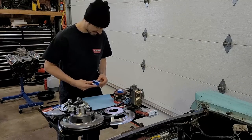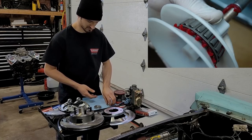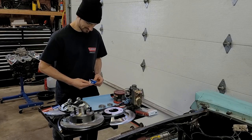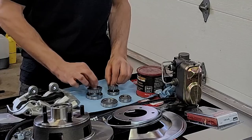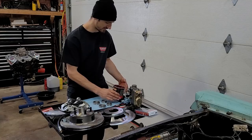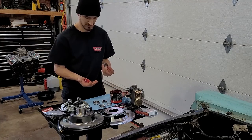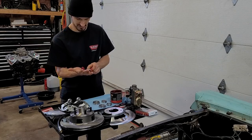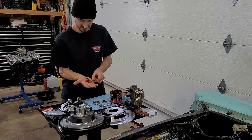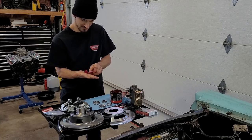So I'm going to get the bearings all packed and ready for install. This is the messy part of the job. There's a modern way of packing bearings now, which is a tool — kind of like a siphon tube — but around here we do it the old style, which involves getting your hands a little dirty. What isn't dirty about mechanics? Okay, we got our bearings all situated. I have the races at the bottom so I can just quickly pop these in and sit them in place. We got our high temp disc brake wheel bearing grease. Stick your finger in there, nice big blob on your palm, grab your bearing on the back side, press it down against your hand, which forces the grease up in between the bearing and the retainer and the inner race. You'll eventually start to see the grease popping out the top — once you see that, the bearing is packed.